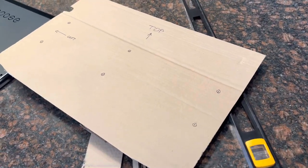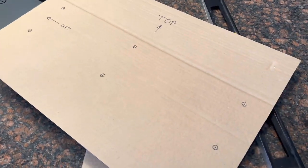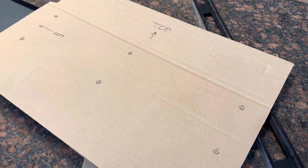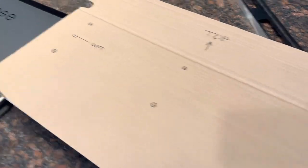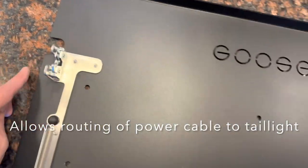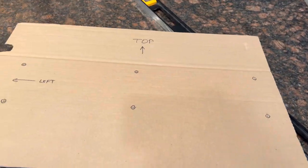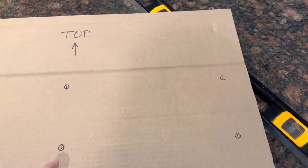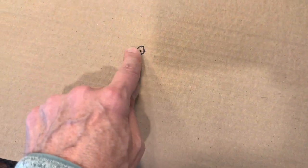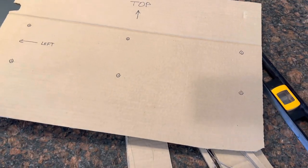Once you've got your template marked up, double-check: put it back on and make sure the marks really align, because you don't want to drill holes in your vehicle that aren't perfectly aligned. Measure twice — or maybe five times — before drilling. Mark your template to keep your top orientation clear so you don't take it out to your vehicle upside down. You can see the notch up here corresponds with the notch on the back of the table. Keep the pilot holes really small — a very small drill bit just to mark the center point — because if you're off at the top or bottom of a hole you start to have alignment issues. Keep these holes as small and precise as possible.